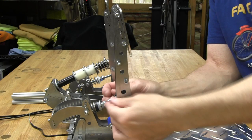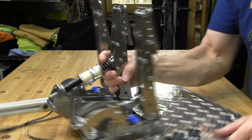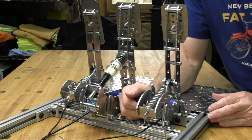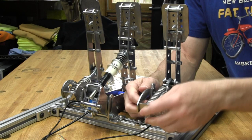In the reference video, the whole spring assembly and rod come out as one piece by removing a couple extra screws, but I found it's better to keep everything together and do it a little differently. Instead of taking it apart, I leave the middle assembly in place. I get in behind the plate and put a little pressure on the spring to take pressure off the back plate where it's sandwiched between the two swing arms. Notice how loose the swing arm is — you don't want it tight and binding.